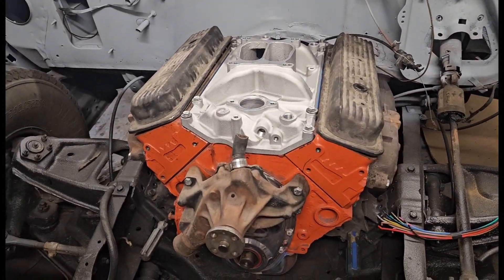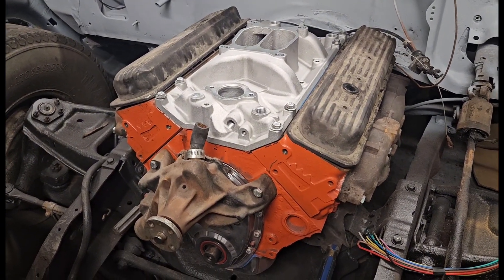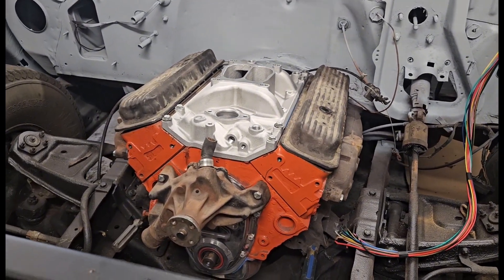Now that we've got the top working and everything tucked in, we're going to tweak the motor and start assembling everything. I've got the motor together, going to do a compression test to make sure I've got compression, put some plugs in it, carburetor and a distributor, and fire this puppy up — then we can see just where we are. Like and subscribe and tell people about the channel. Let's see if we can get this channel to go a little bit bigger. You guys have a good day.